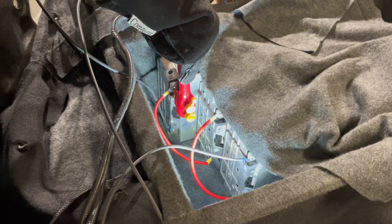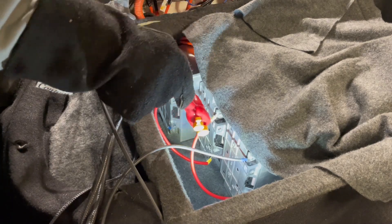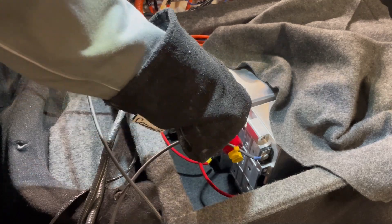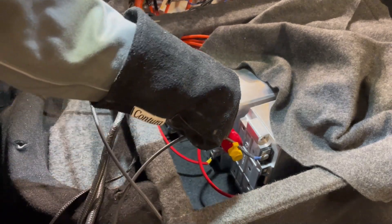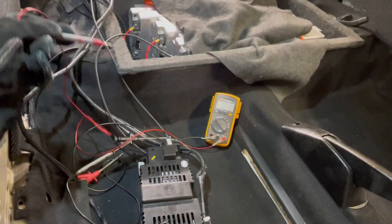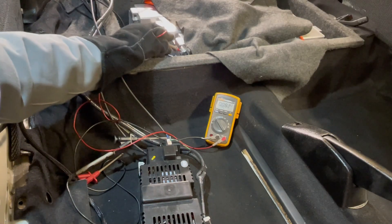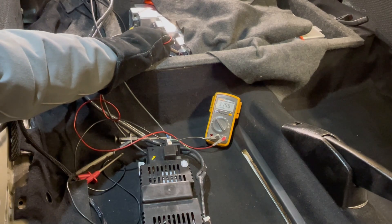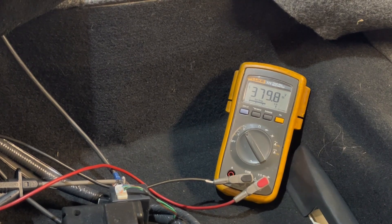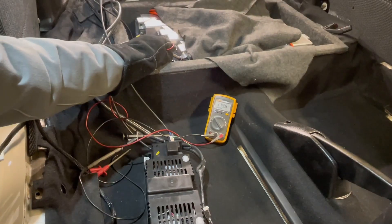This ratchet is designed to work with the voltages we have here. Now all the bus bars are in place and it's time to measure the pack voltage. We have a pack voltage of 379.8 volts, which is around 80% state of charge.